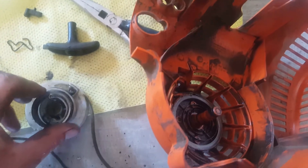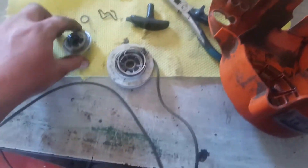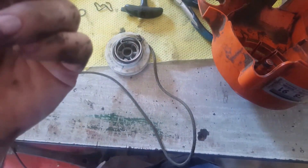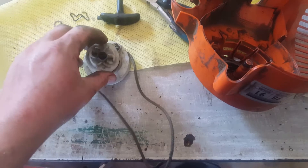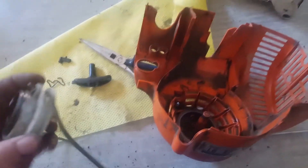So Houston, we have a problem. She bent. This is a recoil — that's a spring, that's that other dopey spring that takes all the load. And it's bent and pushed out, and hence the reason it won't recoil.